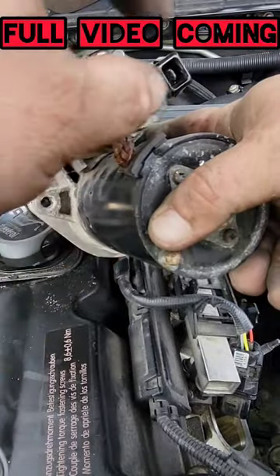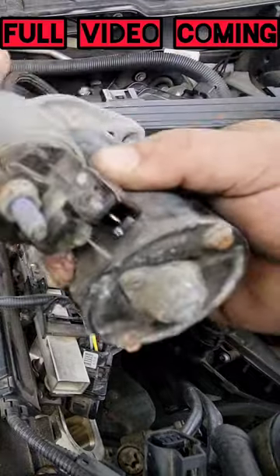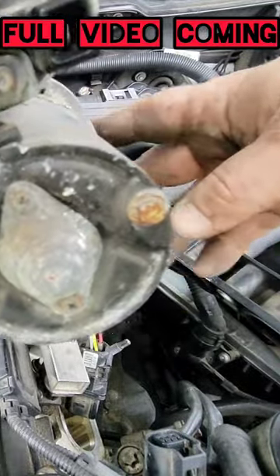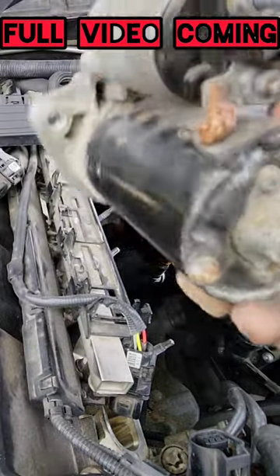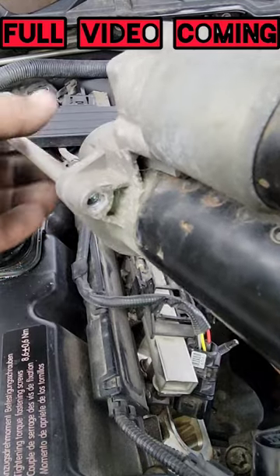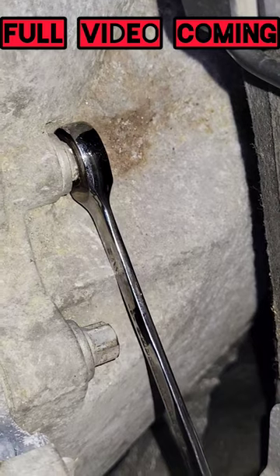The 13mm right here, and then you'll have this little pinch clamp. As it's sitting in there like this, it has one bolt on this side that goes in like normal — it'll be something like that. But on this side, it comes in from behind, screws in like that. So if you don't have one of them spline sockets, you can use a 7/16 wrench.